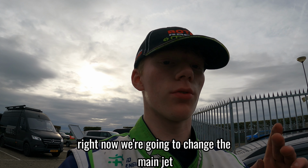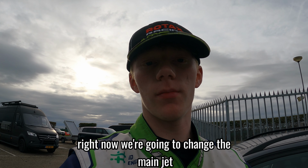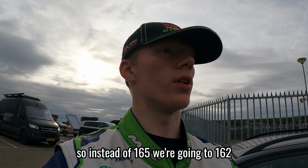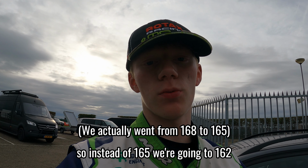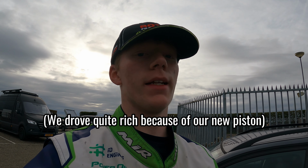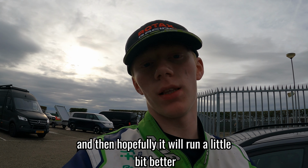Right now we're going to change the main jet to see if we can let the engine run a little bit better. So instead of 165, we're going to 162. So I'm going to be doing that right now, and then hopefully it will run a little bit better.